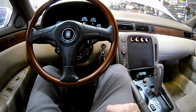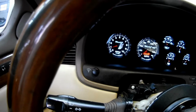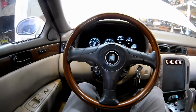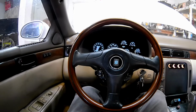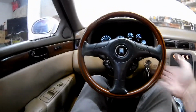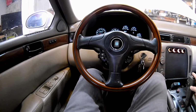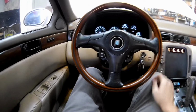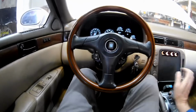So right there, that's at idle, and this idle, which is within 100 of being completely accurate based on the HP Tuners, I'd be okay with this. I'm not getting any crazy vibrations, and it seems okay. But when it warms up and your idle drops down about 200 RPM, you get rattles you don't want. It rattles the door trim weirdly sometimes while you're driving. It's enough to rattle the steering wheel. You get different vibrations through it, so it's kind of frustrating because I'm sitting here, I can feel it vibrating through the seat. Yet I'd probably be okay with that if that's all it was, but it's not all it is. So I will rectify that. Now it's not going to idle down for a little bit, so that's fine.